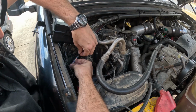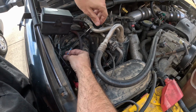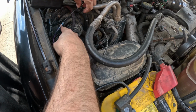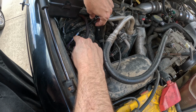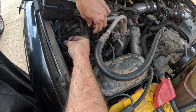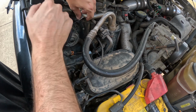So I've got it where it's pretty solid, and now I can line up the connector for putting heat to it. The connector's heat shrink, and it's got a bead of solder in the middle. So you heat it up with a heat gun and the solder melts, and it heat shrinks the tubing down as well. But I always go back over it with another piece of heat shrink.